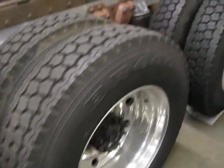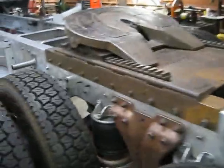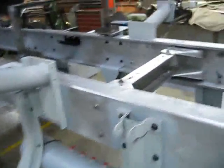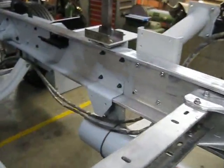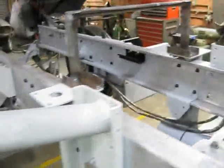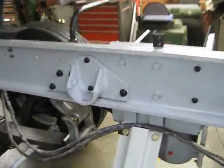It's got the 8V92 Detroit diesel, it's got the 15-speed Fuller. And the aluminum frame, which actually had a couple of minor cracks in it. One of which ended up with me having to remove the engine just to be able to work on the inside of the crack, purely because the Detroit is so wide. Everything's been apart — all new spring pins, just everything.